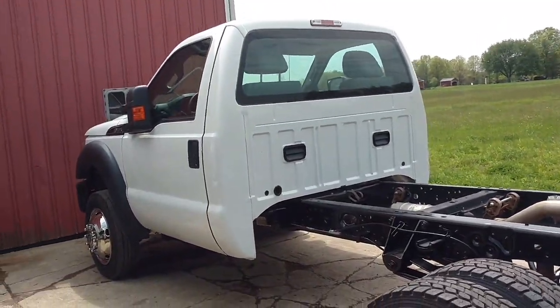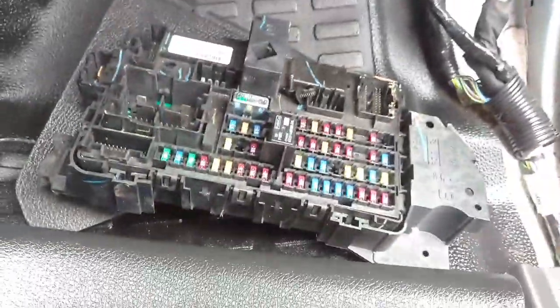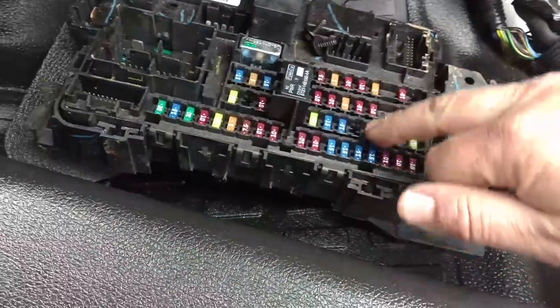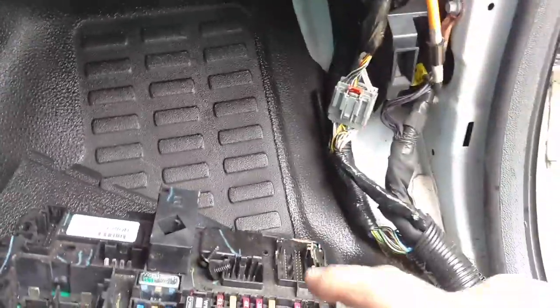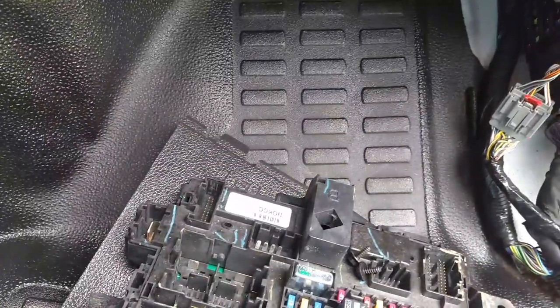Monday they'll be out to do the programming. Like I said, they're VIN-specific — it has to be programmed for the VIN. I left this kick panel off because this is where the module is, right back up in here. This cab obviously had power windows and power locks — the old one didn't. The module is from the XL without those features, so there are a couple of places where the fuses are missing, and the actual contacts are not behind here — the circuitry's not there. This one has the VIN number to my truck embedded in it, and the donor module has the VIN for the donor truck, so they have to program that. I think they also have to enable the cruise control, since my donor truck didn't have it — they have to enable that in the ECM, and that should be it.